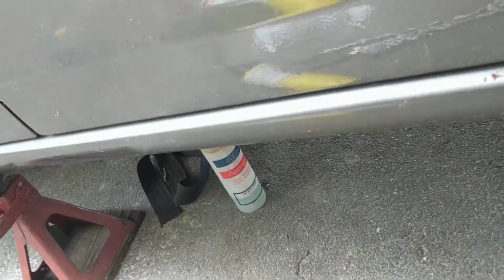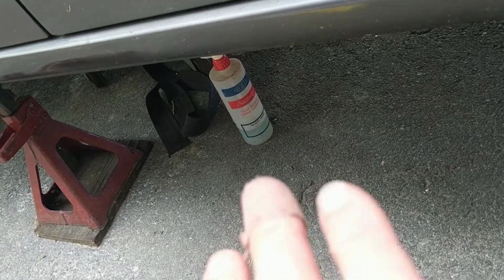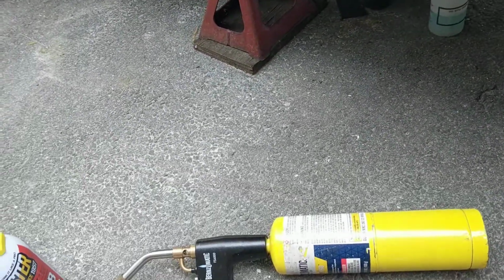So some people on a repair like this, all they do is replace a donut between the catalytic converter and the exhaust manifold, because apparently that's a spot which sometimes fails. In this case, I was able to conclude that the problem was not at the donut. The problem was those holes that I was able to show you.